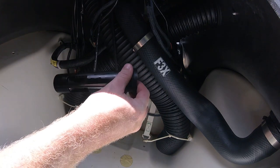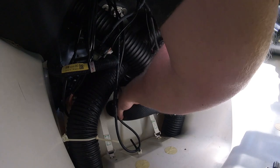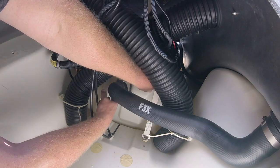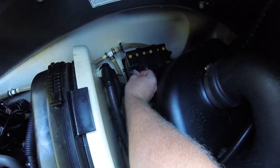Careful not to spill any gas inside of your watercraft. Next, simply reverse your steps: replace the filler neck, tighten it down, and install the divider bulkhead with the four pushpins. Finally, reconnect the battery.